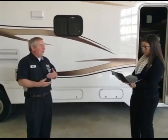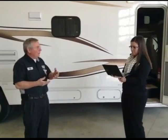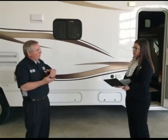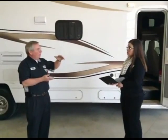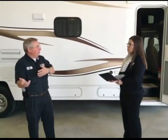So it could be that it's leaking in through a lot of the doors around your compartments, which are all sealed around here. I've seen where the water drips off and gets into here, and once it gets in, it'll wick down into the Coach and run in. So make sure you don't just have a compartment door that's leaking.